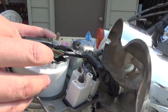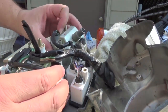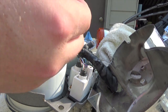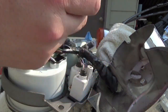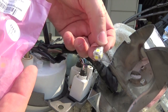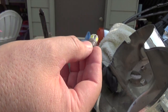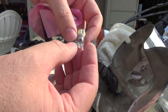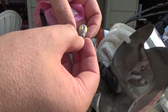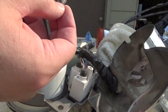These rubber plugs are where the lights live, and these are what we're replacing them with. These are pretty much the standard base — a lot of bikes will have this type of bulb. This is a cluster array of LEDs; a regular incandescent bulb would just have a filament there, but the base is the same. The difference is that this is polarized, so if it doesn't work the first time, you just pull it out, flip it around the other way, push it back in, and it should light up. You have to test every one.